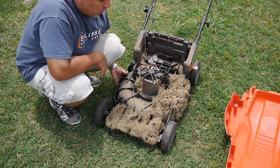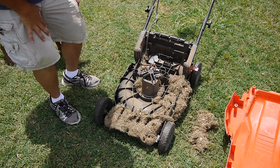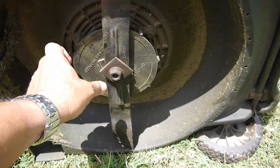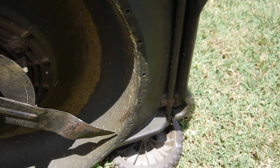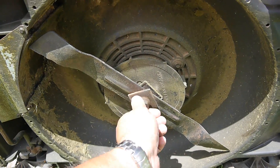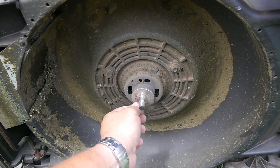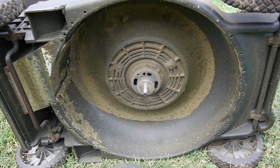It's probably clogged up. When I was looking at the blade — let me give you a good shot of this — how loose it was spinning around, but it's awfully hard to turn the actual motor. This is just freewheeling right now, but once I take this off — yeah, it should be freely rotating, so the motor's jammed up here on the front. Let's take it apart, clean it up, and see if we can get it working.